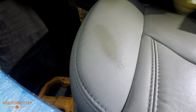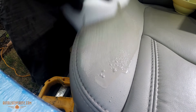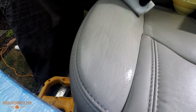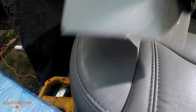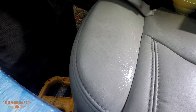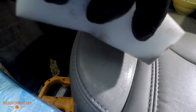So we're going to take the dye, dip the sponge in, let it run down a bit, and just start wiping the seat down. You'll see I'm starting to get some coverage — keep it really light. If you get any that runs over, flip the sponge and soak some of it up. It's kind of like painting a green wall white: when you put that first coat on, you can still see what's underneath. As you layer the coating up, that's when you achieve full coverage and get the full color of the dye.